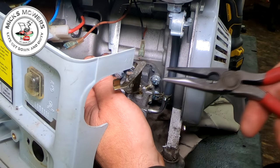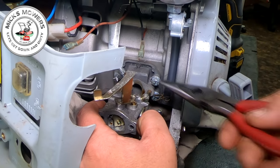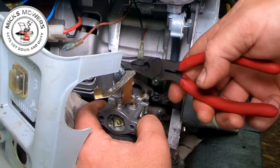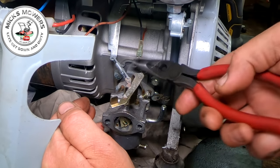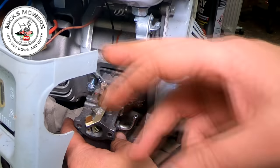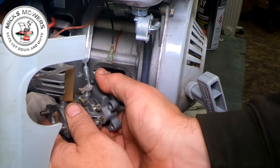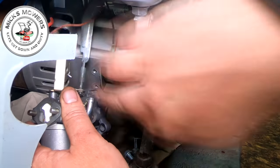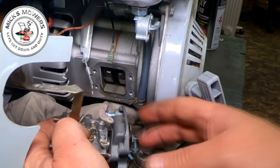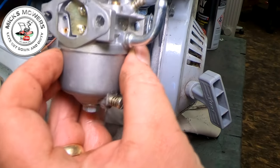I've found these are quite tricky to remove on these because you've got to bend them up. What I've found is easiest is to bend the governor arm on this side here, bend it round so it comes off because you can't tip them up beforehand. I end up undoing these four bolts off of the manifold itself, and now you can remove it off of the governor off the carburetor — which is a bit easier. There it goes so it comes off now. Make sure that when you're going to put this back on, it goes the right way up. There's a little carby — let's get it over to the bench and we'll have a strip down.